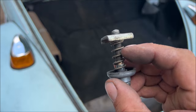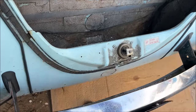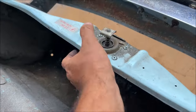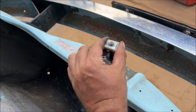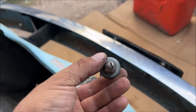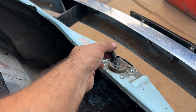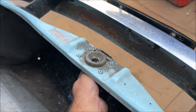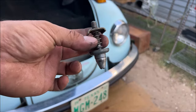So I'm going to go to the hardware store and try to find a stronger spring because I think that's the problem right there. Look at this — if we pull the cable, okay, look at that. That's why it's not opening the hood: my adjustment is all the way out. There's a flathead place — we just screwed it in, put some tension on the spring.